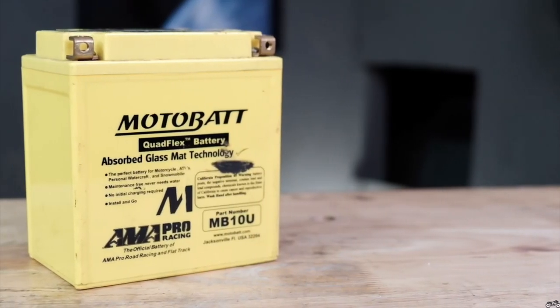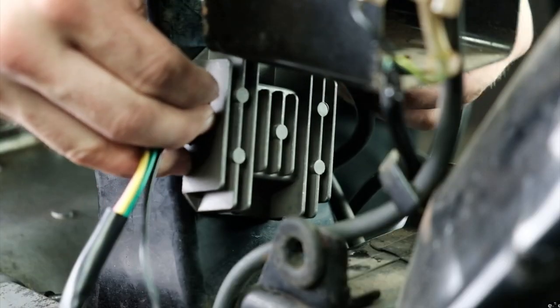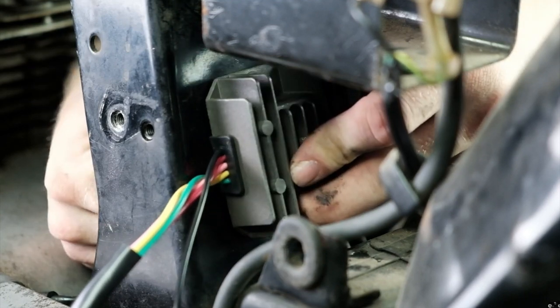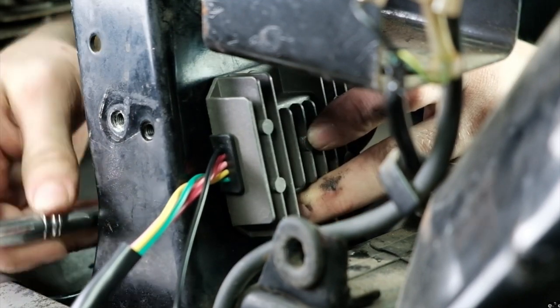The first thing is a good, healthy battery. We recommend an AGM battery or a lead acid battery — we'll have a link up in the corner to a video that talks more about batteries and battery options and why that's important. A healthy battery that's at full charge is key. The other one is an updated voltage regulator and rectifier. This is one of our combo units — we go into more detail in another video. It's definitely the number one electrical upgrade on all of these bikes. So assuming you have a good battery and a good rectifier and you're still having charging problems, then we can dive into the stator itself.